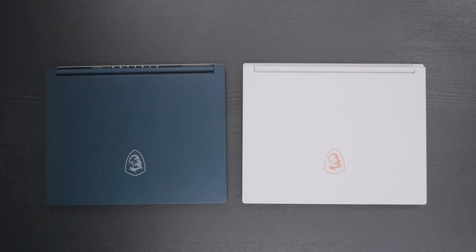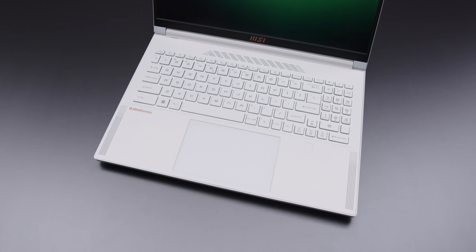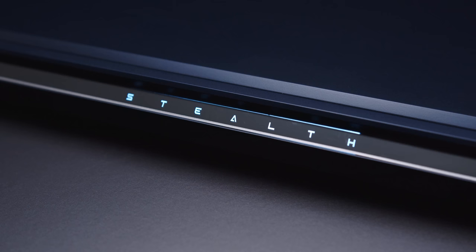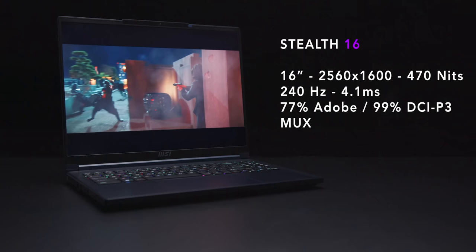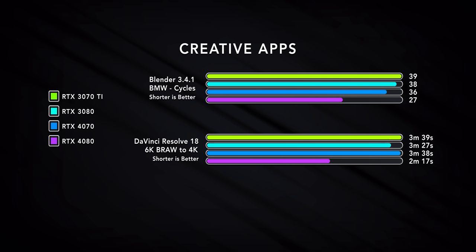On the 16-inch models, the blue unit still has a blue top panel and keyboard deck, but it adds a number pad and a fingerprint sensor. The white 16-inch model has a white interior and exterior — there are so few fully white laptops out there and this is one of them. On the back there's a more professional-looking Stealth badge that lights up, but it can't change colors — it stays gold and white. The screens on both the Stealth 14 and 16 have a 16:10 aspect ratio — fast, great colors, good brightness, awesome for gaming and content creation. The 16-inch with the 4070 at 105 watts runs kind of like a 150-watt RTX 3080. Creative workflows don't seem much faster though — I think it's held back by the 8 gigs of VRAM, the 128-bit bus, and fewer cores. I wouldn't be surprised if certain memory-bandwidth-dependent workflows are actually slower on the 4070 compared to the 3070.